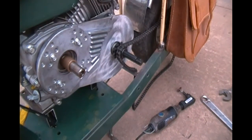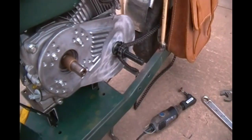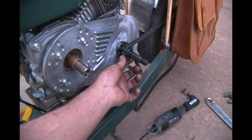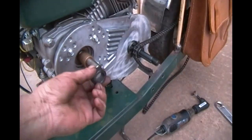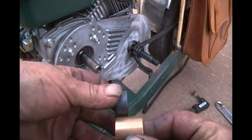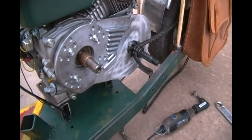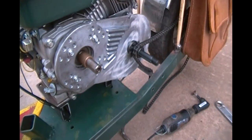Check this out — I took the 41-pitch chain gear and put it on there, and put the 35 chain there, and man, that has got it lined up just about perfect. And this is the bushing for the front that came with it — I had the foresight when I saw some of these one day and grabbed one. It's twice as big and that's a little loose on there anyway. Put this one on there and should be able to put it together. The cover may not fit because everything's sticking out too far, but I can at least put it on there and see what happens. I'll have to cut that chain and get it to fit, but that's okay — I'm not going backwards anyway.